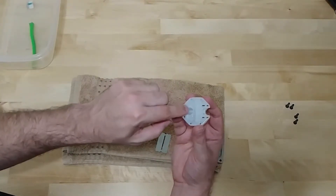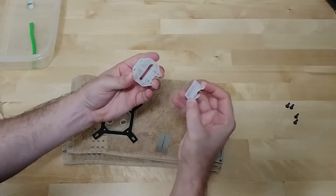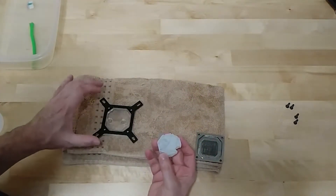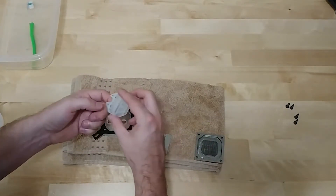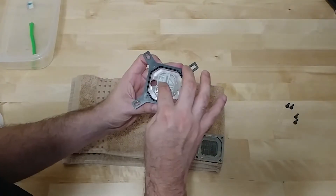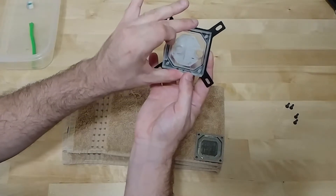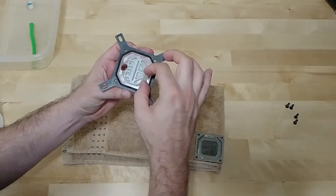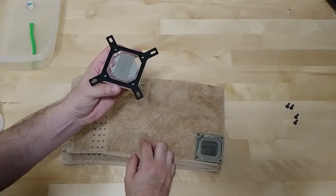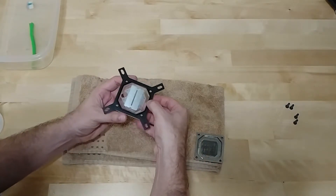The easiest thing to do is put this water diverter piece back inside first. The open part goes toward the outlet, because you can see the fins through there. Put it back in and it should slide right into place where you can see through the outlet. Water comes in, splits, and comes out through here — across from the jet, which is now in the correct spot — and then to the outlet. Everything is set back up.